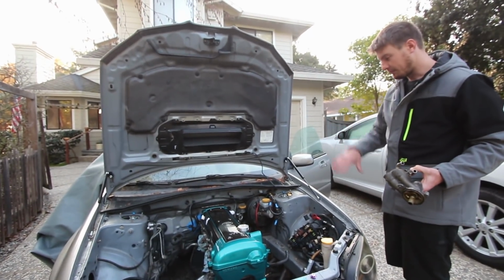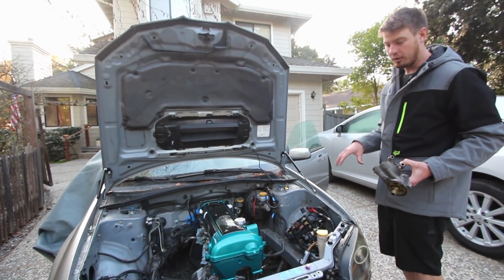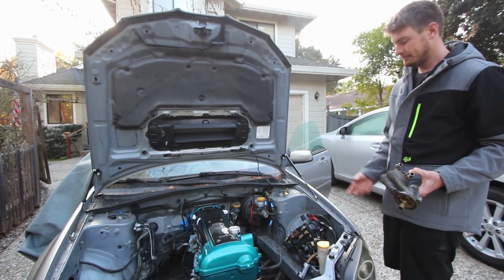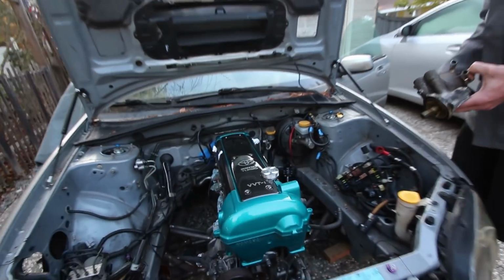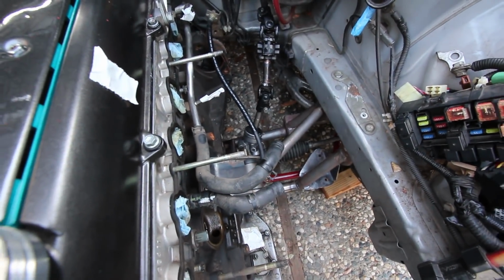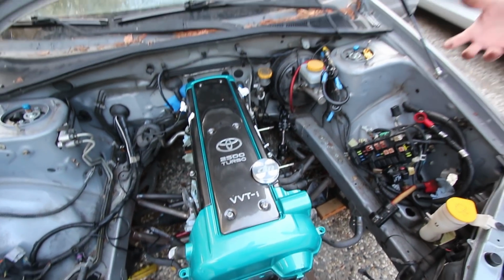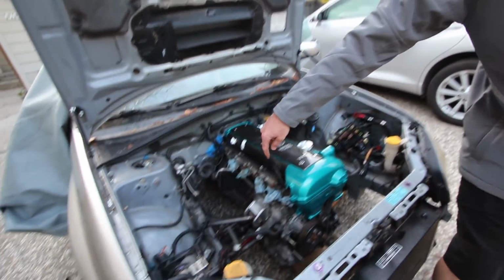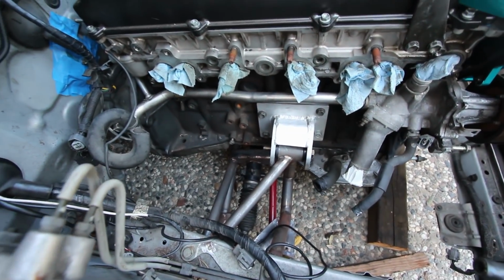When I got that started, I basically didn't know where the engine mounts needed to be. So I just built the subframe, bolted it in place, put the engine in where I wanted it, and set the engine on blocks, so I knew right where it all had to be. And then I just kind of said, that looks like a good spot, and guessed where I was going to put the motor mounts. Put the engine mounts on the subframe, put it back in the car, and then I took everything on either side of the motor here, and I made these plates on each side.